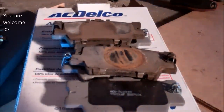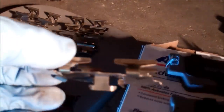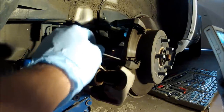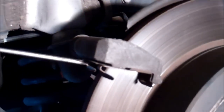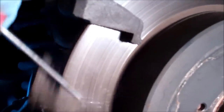These are the clips that are designed to make that hideous squealing sound as a warning. Now if you look at the replacement clip, you'll see that there's a little tab here that sits down inside of the brake — this is where the brakes rest, but we want to pull that out, so that's really the only thing holding it in place. We'll take a screwdriver and slide it underneath there and pop it up. To remove the clip, take a flathead screwdriver, slide it in there, just pop it up, and don't worry about damaging it because you're about to put in a new one. There you go, clip gone.